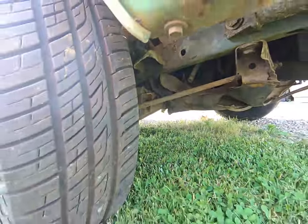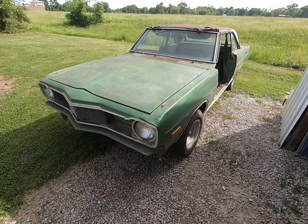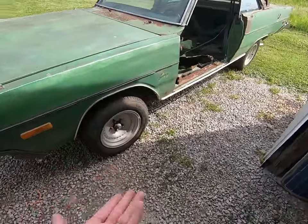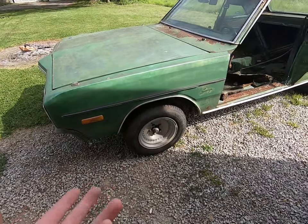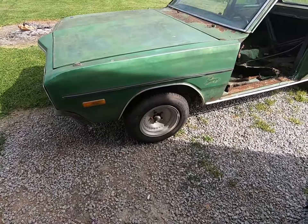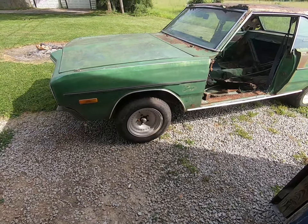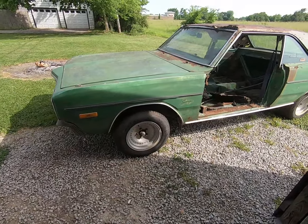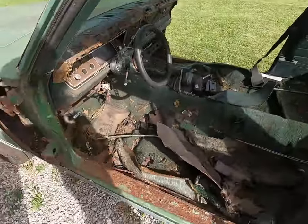I do have the template for the exact mount — the location is a little iffy — so that will provide the proper location. Ultimately, we can switch this front suspension over to the '72 Duster and have a more modernized setup with the brakes and the big bolt pattern. You get a wider variety of wheels, a couple safety features in the motor mount situation, and the brakes are really good. A lot of people say their brakes aren't that good in one of these, but they really are if you keep up the maintenance and get new parts when you need them. These aren't really heavy cars, and they're pretty big brakes for the size.